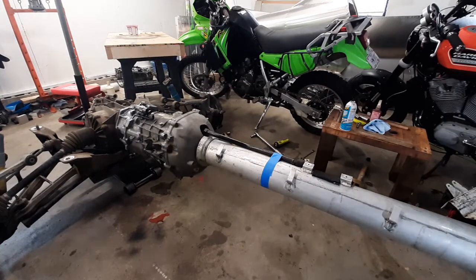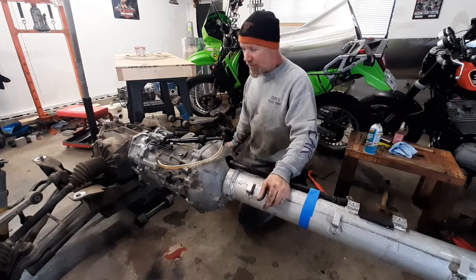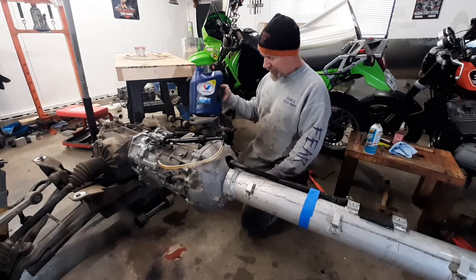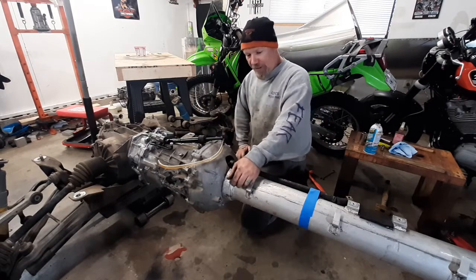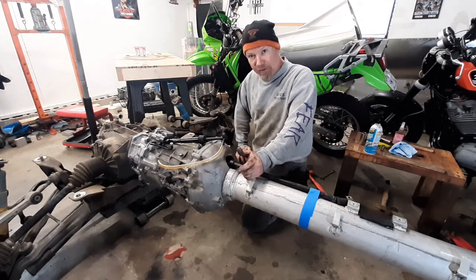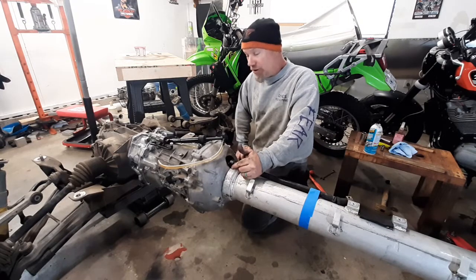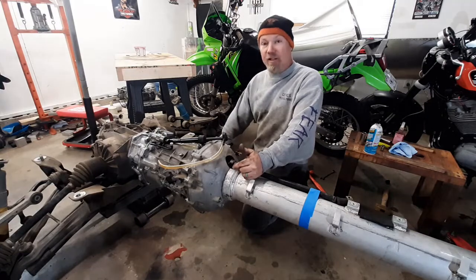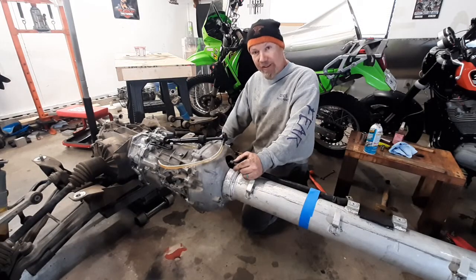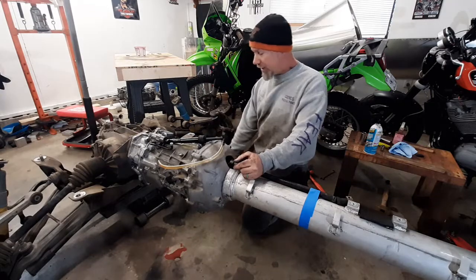Now while everything is straight and level, I'm going to go ahead and fill the transmission up with fluid, because it's a lot easier to do it now than after it's in the car — and you don't want to forget it. These transmissions are designed to run on Dexron 3. I'm going to fill it up with Valvoline Dexron 3 — just the regular mineral-based stuff. There was some debate on older transmissions like this one: when they had paper synchronizers, using synthetic fluid could damage the blocking rings. I don't know about that, but this one has carbon fiber rings now, so you can use synthetic or regular mineral base — whatever you want, just use Dexron 3. I've run Mobile 1 synthetic and I've also run this exact mineral-based stuff, and I couldn't tell a bit of difference between the two. Both work perfectly.